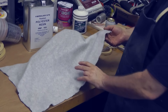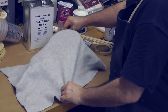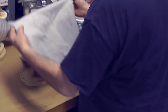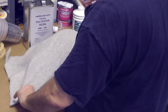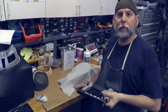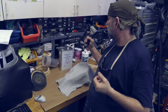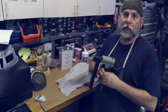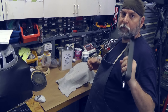A word about this fleece — I think my wife picked this up at Joann's. It's just a polyester fleece. It does have a direction — it stretches better in one direction — so I try and get that going in the hardest direction. There's a furry side and a not-so-furry side, so try to have the not-so-furry side up or you'll spend a lot more time sanding. For the next step, I'm going to staple the fabric down to the frame while stretching it, using an air-powered stapler.